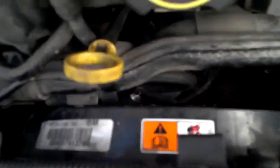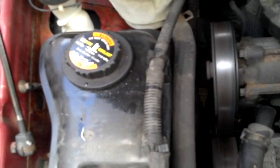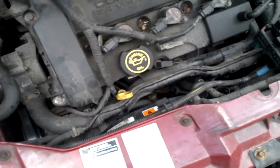So you lower it down and evacuate the system with the airlift. All back together and running. Kind of see a new clamp down there. That airlift tool I used in one of my Explorer intake manifold changes. Excellent tool to buy. About 200 bucks, 180, 160, wherever you find it from. But it sucks down the system and makes sure there's no other leaks. This one held about 25 on the gauge, and then I walked away and it held, so we got no other leaks.